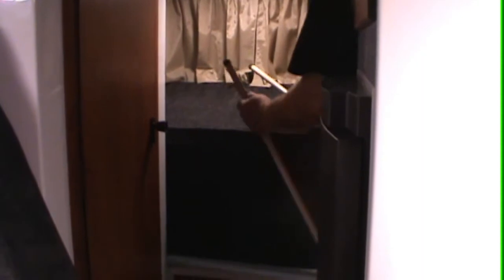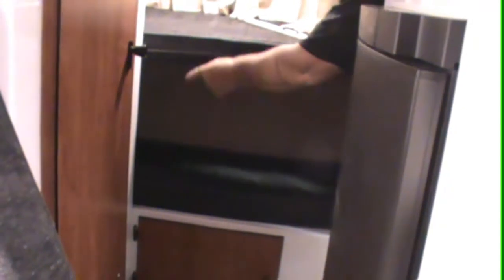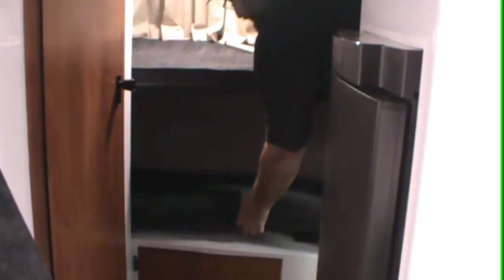When it comes to setting up your bunk beds, all you do is pull the cushion up out of the way, stand this one up, reach back — there are two bars. The cushion is on a hinge; grab a hold and bring it up. Each of these pipes has a bar underneath; put the head of a screw through the hole and set it in the holder. We do not recommend traveling with the bunks up, and we do not recommend more than 150 pounds in the top bunk. Underneath here you have storage — there are three separate compartments.